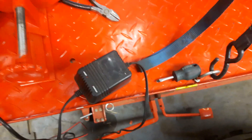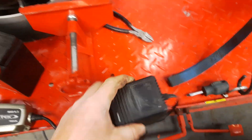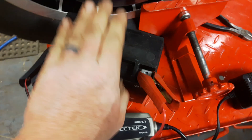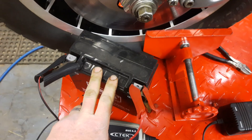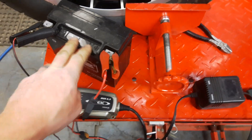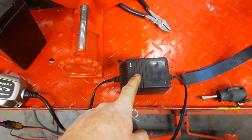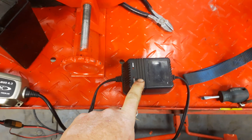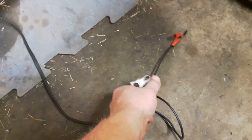I find that if you take this unit — which I bought, I think at Canadian Tire for about $30 — and you connect it to one of these totally flat batteries, whether it's a motorcycle battery, car battery, lawn tractor battery, any kind of 12 volt battery that will not start one of these chargers, hook up this 100 milliamp, 12 to 14 volt DC transformer. It's just got a couple of simple alligator clips on it.